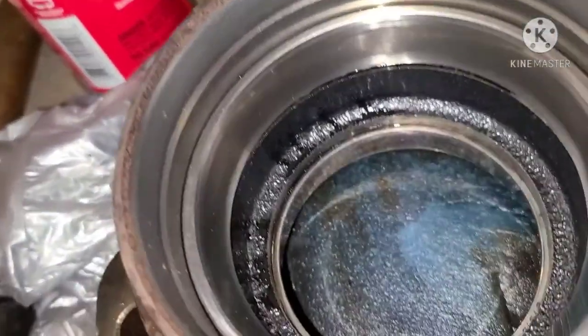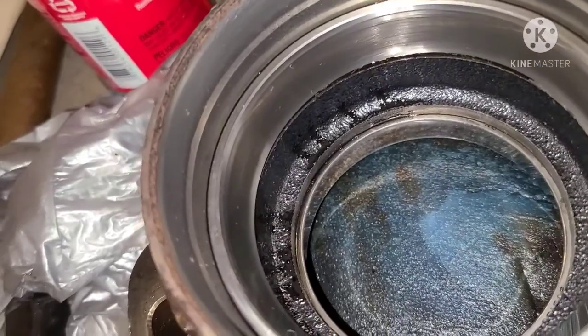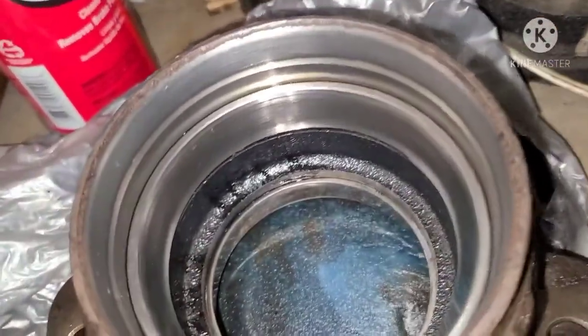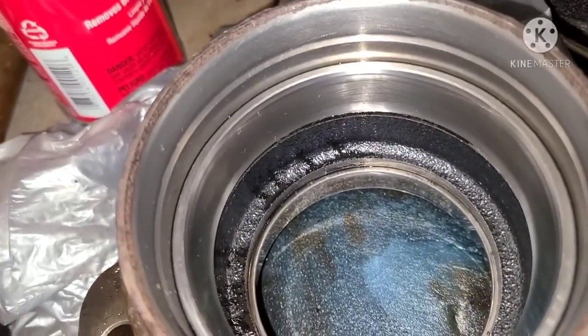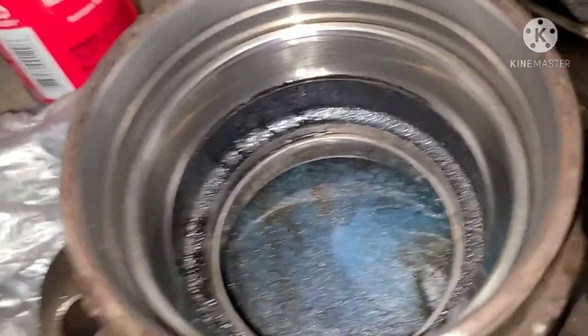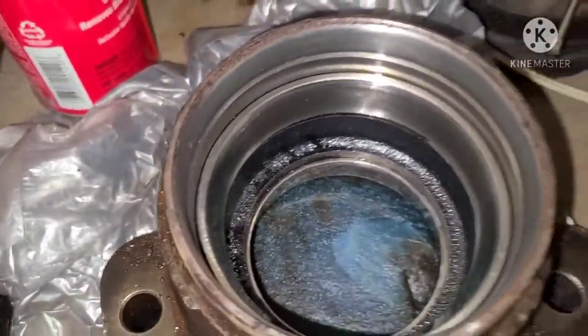That chunk in the middle is just cast metal, so you don't have to worry about getting that super pretty. You just want to make sure all these surfaces that are either sealing or having a bearing riding on them are going to be perfect. So we'll go through one more time at the end and make sure we don't have any of those little fuzzies left over from our towel and get it all perfect before we drop the bearing in.